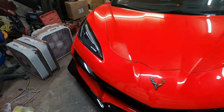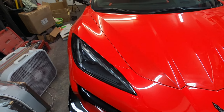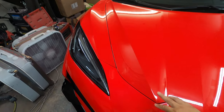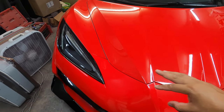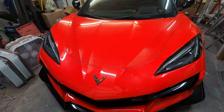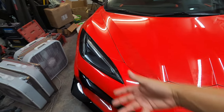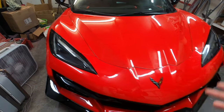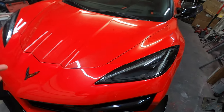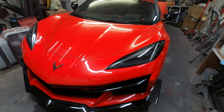I don't want to turn it like this — this is not what I do. I knew better to blend it, but I didn't, and this is what I got. It's just a little bit off. The reason I didn't blend it was because I was hoping the color was going to be close enough that I didn't have to mess with the factory clear. I feel really dumb now because I've got to take this whole thing apart again, brace material and stuff like that. But it's okay — thankfully the customer understood and I'm going to fix it.